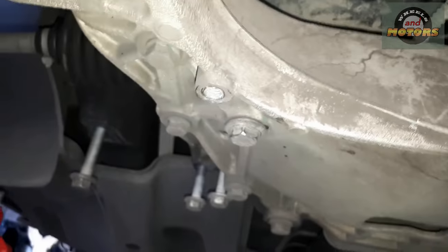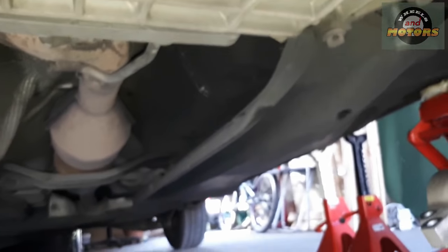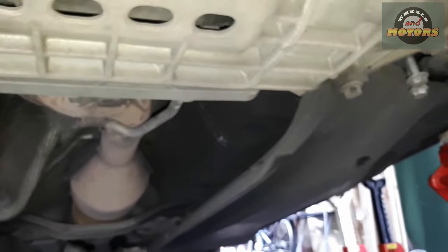Once again, there are four bolts - four big bolts, you won't miss them, four big bolts like this - and there's inside there. Four big bolts hold the subframe, three bolts that hold the steering rack: one, two, three. Then disconnect the arms - simple. And then of course we have the anti-roll bar.